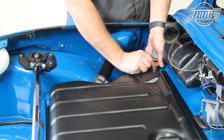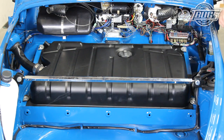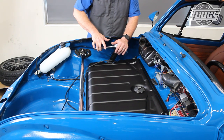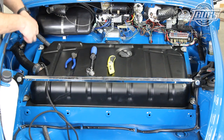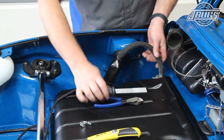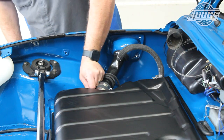The fuel tank bolts and brackets are installed at each corner. Note that the raised edge of the bracket sits against the body, not the tank. We install rubber caps at the vents at the left corner of the tank. The original filler neck fitting is installed along with the fiber washer and tightened down. We install and clamp on a length of vent hose at the corner of the tank, loop and route the hose to avoid kinks, cut it to length, install onto the filler vent, and clamp it in place. The vent line we ran underneath the tank earlier is looped around the filler neck a few times, cut to length, and attached to the vent line on the fuel tank.